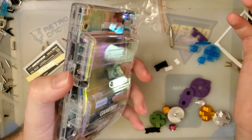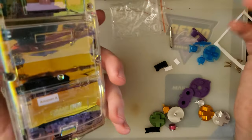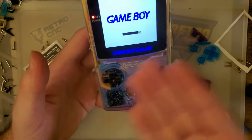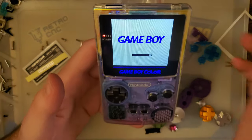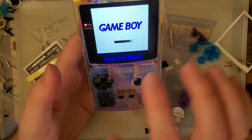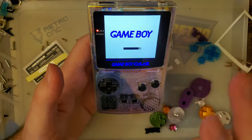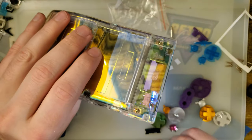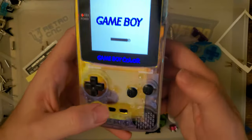In a lot of the other kits, that doesn't seem to matter because if they detect corrupt data, they just reset on their own. But for whatever reason, this kit was just never programmed to do that. Now, again, I have no idea if this iteration of the kit has been updated to fix that bug, but if not, we have a manual workaround.